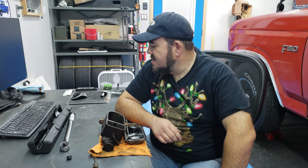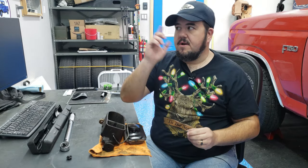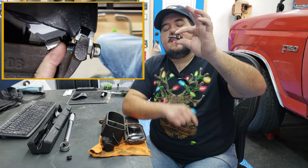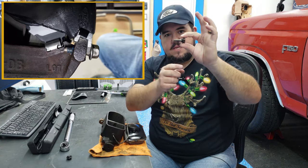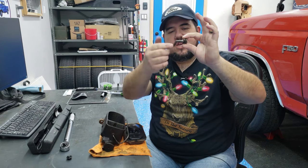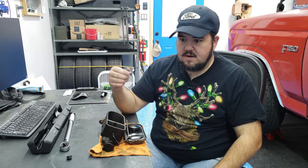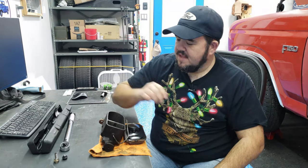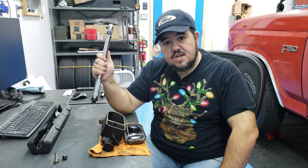And I just, that was a rough day, man, let me tell you. Luckily, this bolt, and I'll get a video of it so I can put it up here on the screen so you'll see what I'm talking about, actually goes all the way through the knuckle and sticks out the other side. So I was able to get a pair of vice grips on the other side of this and turn it from the opposite direction and back it out. So I didn't have to do any drilling. Thank God I didn't have to replace the knuckle or do anything weird like that. I managed to get that taken care of, but that was a rough day. So this thing is going in the garbage.